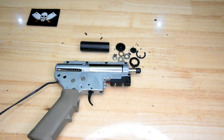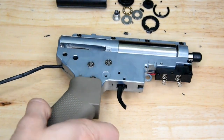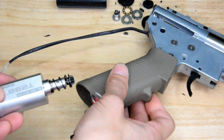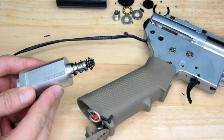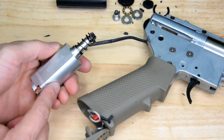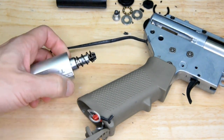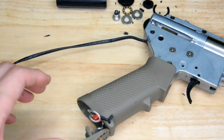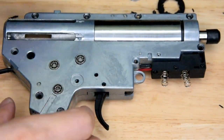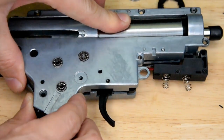I was expecting a massive failure. It's definitely not doing as well as it should be, but let's take a look at why we've stopped. Popping the T238 brushless motor out — it's a little warm, not too hot. Pinion gear looks fine, no problems there. Now let's have a look inside the gearbox and see what mysteries lie within.